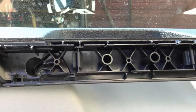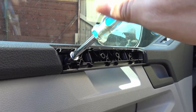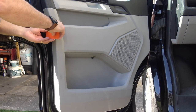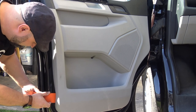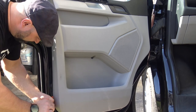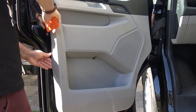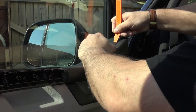There they are — nice little silver dudes. It's always a little bit troubling when you're getting these little plastic pry tools and pulling things apart like that. I never really liked doing it. But apparently everything's fine and it's perfectly normal. So go on, get in there. Don't be shy. You actually have to put quite a bit of force on the door card in order to break it free. But once it's free, the bottom of the door card sort of swings backwards and forwards. Then you've got to angle that towards you and lift the whole door card up.